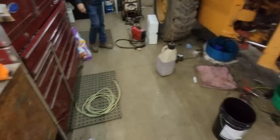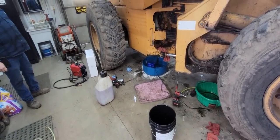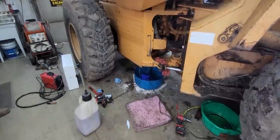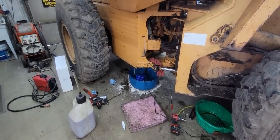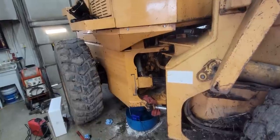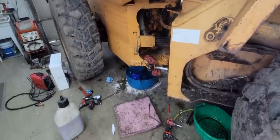At least it's out. Now what we're going to do is flush the transmission. I got a good idea — I took the pump out of the Napa parts washer and I'm going to try to circulate some diesel fuel through the pan of the transmission to rinse it out. Then we're going to come through the top hole and try to rinse out up through there and see what we can get out.